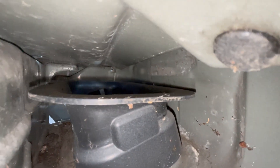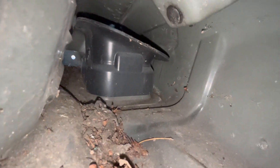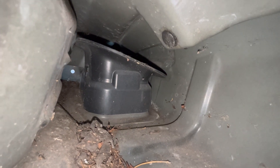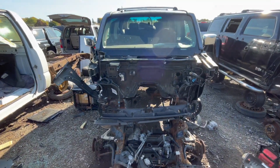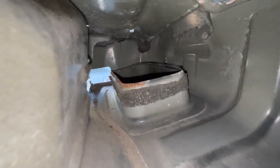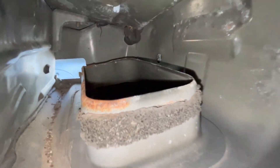There's not really a lot of room on top to get a paper filter in here, so what I ended up doing is removing that entire plastic assembly to make room for a paper air filter adapter. Once it's removed, the setup that remains is identical to the setup on a 2004 to 2012 GMC Canyon and Chevy Colorado.